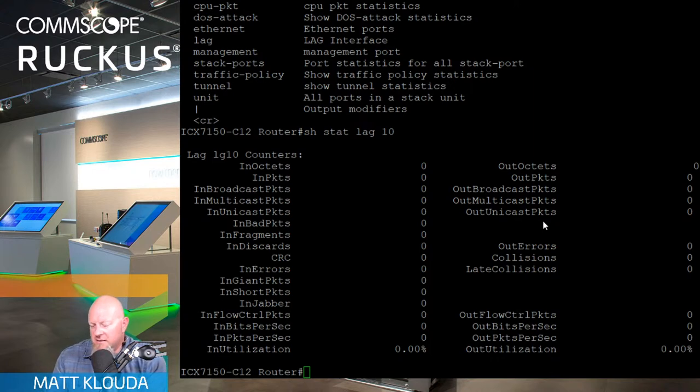What the BSS min rate does is it's not necessarily handling the speed of traffic at what you're uploading, downloading on your device. It deals with your management and control traffic. So if my phone can't transmit the management and control traffic between it and the access point at a rate of 11 megabits per second, that access point's basically going to say, no way, dude, go somewhere else. And what the phone will do is say, oh, I lost connection to this access point within my mesh. It's going to jump to the nearest one because it needs that strong connection, because the access points are saying you have to be strongly connected.